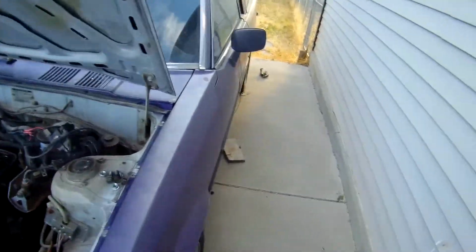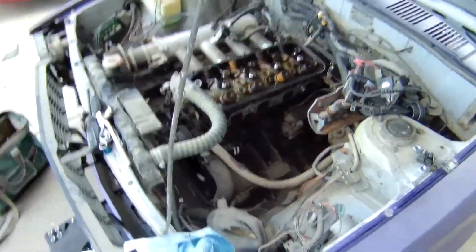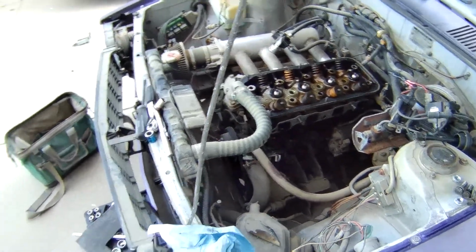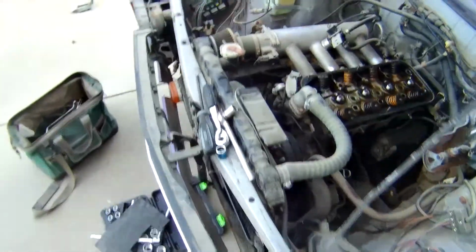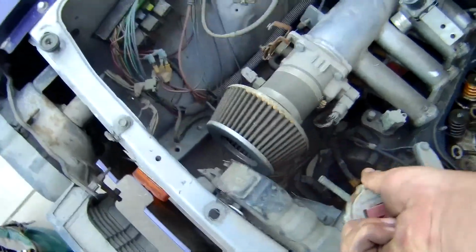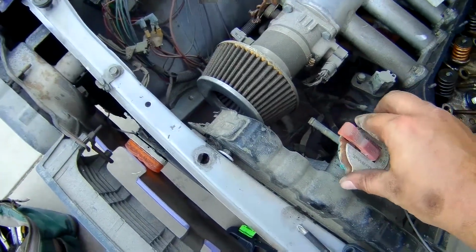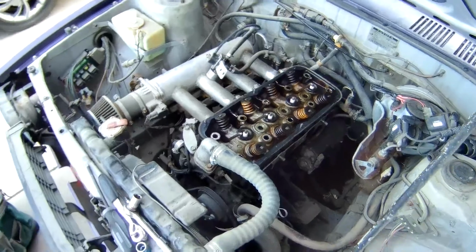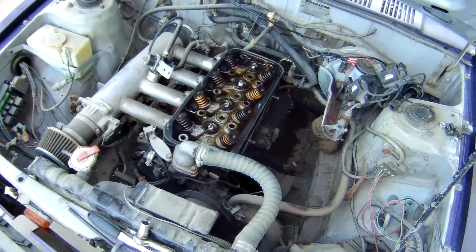So, I'm guessing either a head gasket bit it somewhere around that cylinder, or the head cracked, something like that. Thing is, its temperature never got hot. If I recall correctly, well, it's empty now because it's been sitting for a while, but when the issues happened, never really saw smoke, no white shit, temperatures never climbed, never heard any boiling.